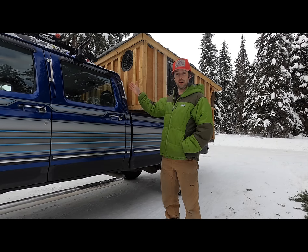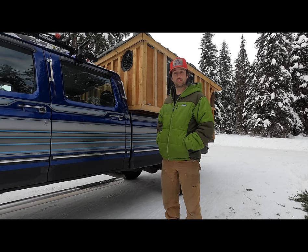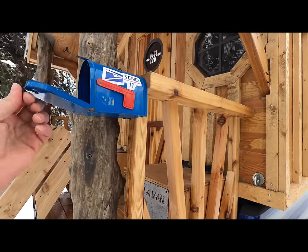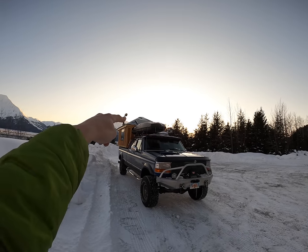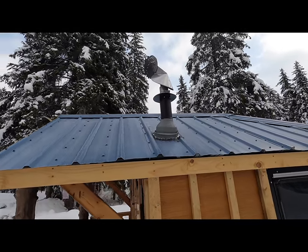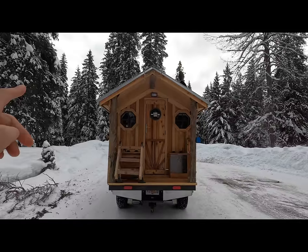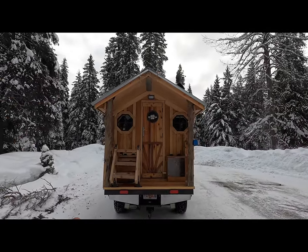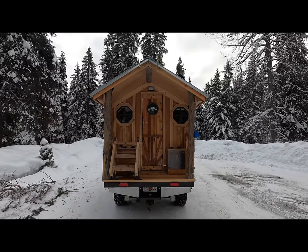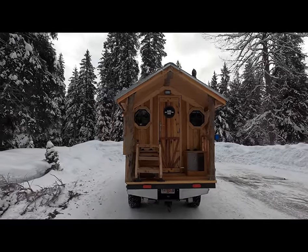All the windows are double sealed — sealed with silicone tape and then I also put silicone on top of the silicone tape, which really helps waterproof the windows and seal all the water out. I kept getting messages left under my windshield wipers so I decided to put a little mailbox in there — I thought that was kind of funny. Up on the roof I've got a 100 watt solar panel, and for the chimney flue I use a 3 inch wind-directional chimney cap that rotates and creates a vacuum so you can actually have a fire going while driving down the highway. The roof of the camper has a 5/12 pitch — most campers have a flat roof where water accumulates and leaks through, causing water damage. This camper sheds water off instantly.